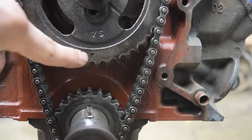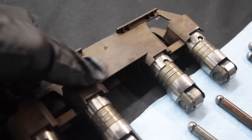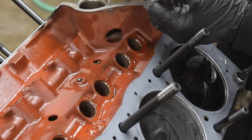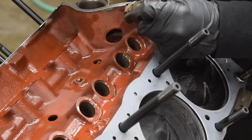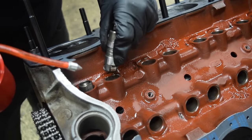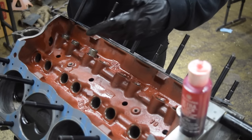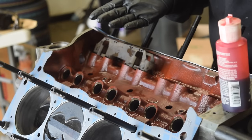Our timing dots are in line. I started cleaning up the lifters and their retainers — just to give you an idea of how dirty they were, this is the one I just cleaned compared to the one I have not cleaned yet. You could hear and even see all the grittiness. With all the lifters cleaned up, I'm just going to place a dab of the assembly lube on the roller — we already have some on the cam so it's not that necessary, but just in case. Then I'll generously apply some oil. Some people like to soak these in a petri dish with oil for a while, but I don't want to do that because that'll mess with the accuracy when we're trying to set our valve lash or preload. We will ensure everything is properly oiled by priming the system before the first start.